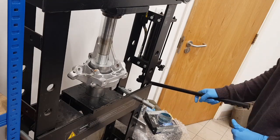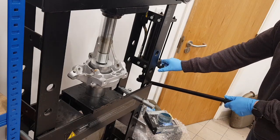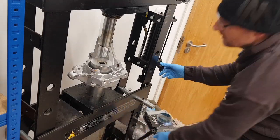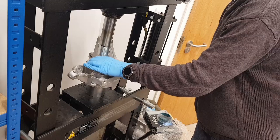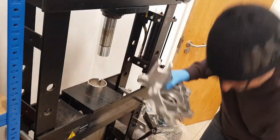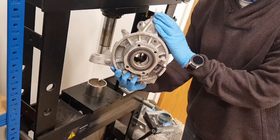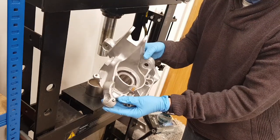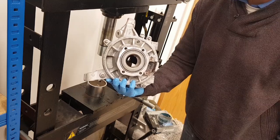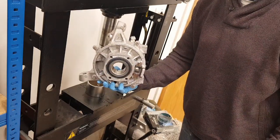It's fully home now and starting to register on the gauge. As you can see, the bearing is now seated in there. I'll be able to put the cover on the front now - that will be bolted on and torqued up correctly - and then I'll be able to put the actual drive flange on.